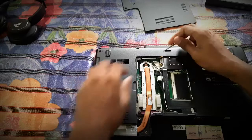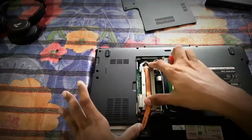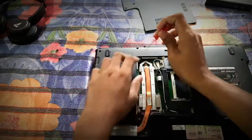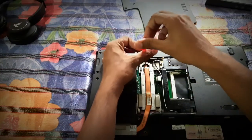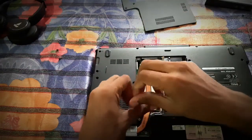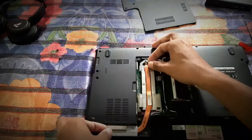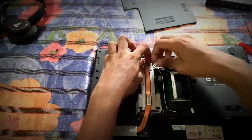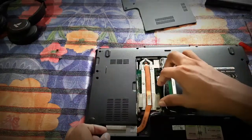Be very careful handling these things. After that, we have to remove this heat sink — I have a copper cooling system. For you it may be only a fan or some other thing. You can just remove this by removing the screw here. After removing those screws, you can separate this heat sink. Before that, make sure the Wi-Fi wire is secured, and then you can just remove the heat sink from here.